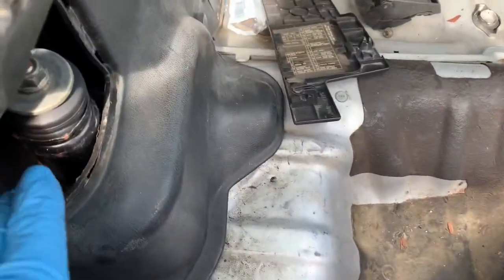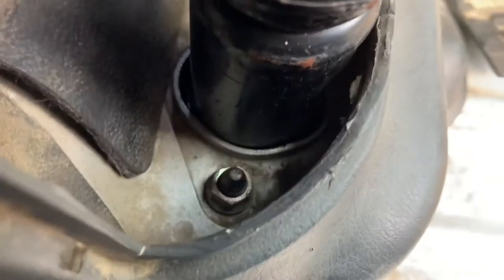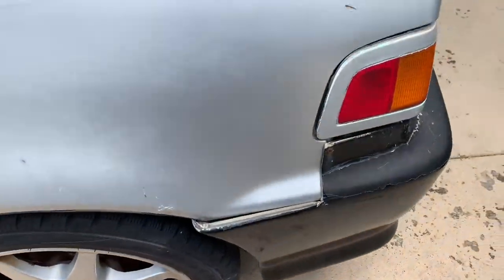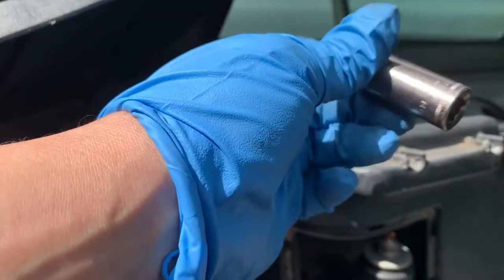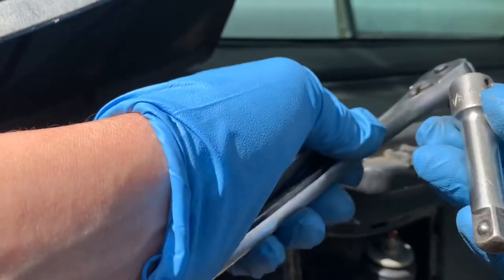Today I'm going to show you how to remove the rear suspension for the CRX. We need a size 14 wrench on both ends, and we have to loosen up the lug nuts on both sides. Tools needed: 14 millimeter deep socket, ratchet, and possibly an extension.